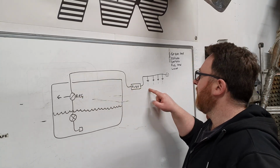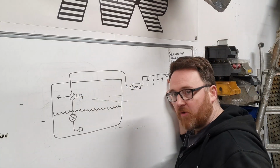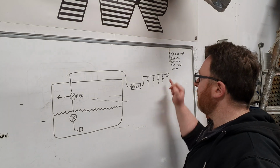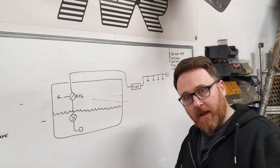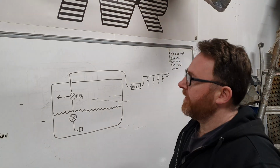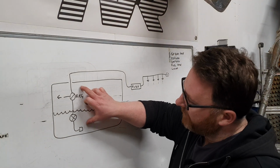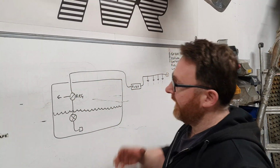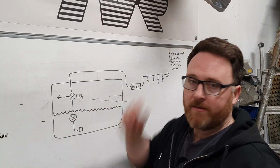It's actually a really simple system, and it means there's nothing but 4 bar of fuel pressure going through a filter, up to the injectors, and then at the end you've got a damper, i.e. something just to help control and regulate that without returning anything to the tank. Ergo, returnless, or as some folk call it, a deadhead system. The problem with this though is, all of that module is actually a bolt-in thing on the MX-5's tank. So it's a whole assembly that you need to put in and take out.